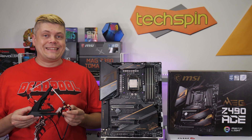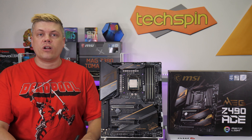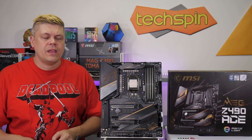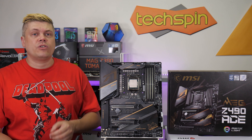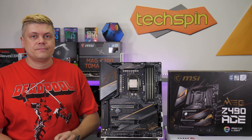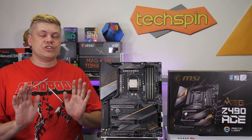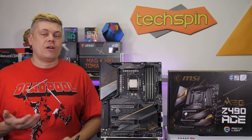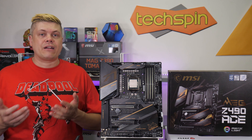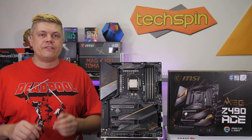It's great to see Wi-Fi 6 included along with a desktop antenna. For an entry-level to mid-tier board we'd be perfectly happy with 2.5 gigabit ethernet, but this is a more costly enthusiast motherboard and for the price we would expect to see 10 gigabit ethernet onboard. Granted, market adoption is still slow, but we're really pushing for this change. As more 10 gigabit motherboards hit the market, the price for 10 gig routers and switches will also come down, so we want to see this on boards at or above $250.